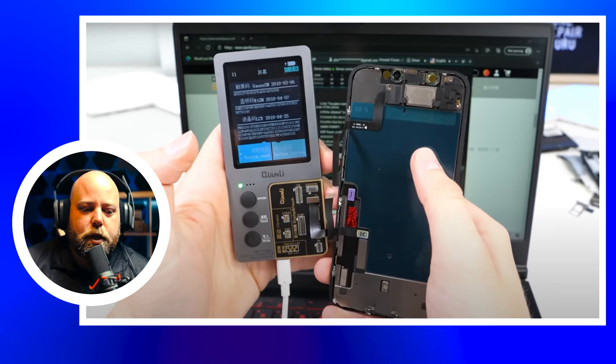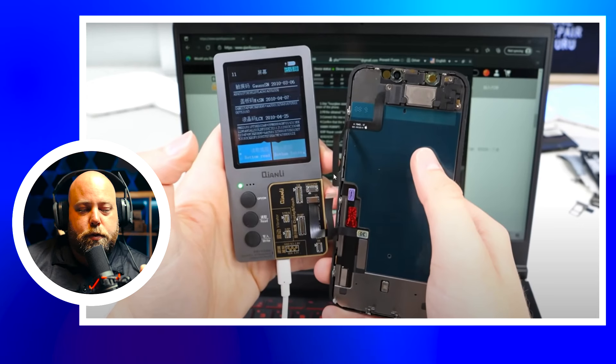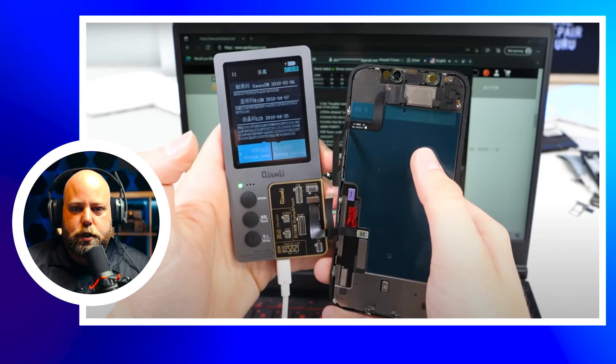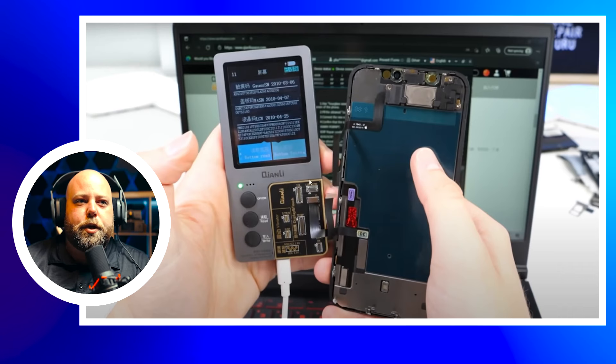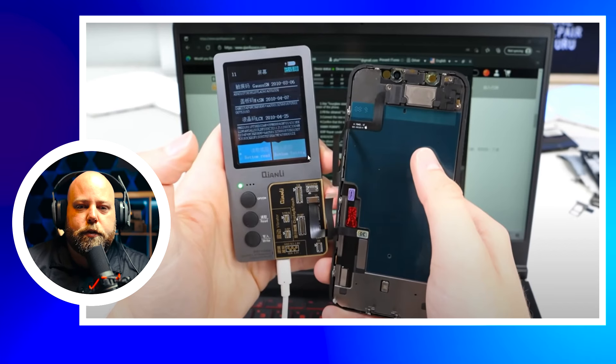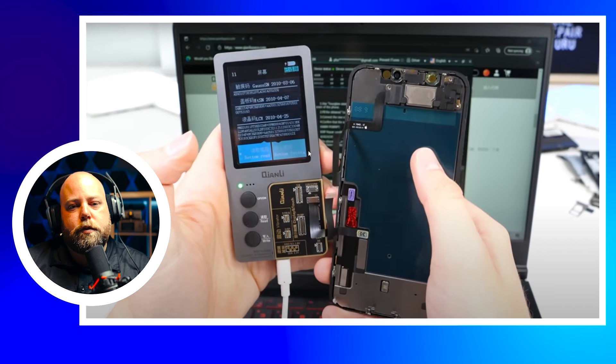We'll put the LCD back on the iPhone 11, boot it up, and this is the moment of truth. The replacement screen already on the phone is a Mobile Centric screen — you can see the red Mobile Centric sticker. The reason I point that out is because not every aftermarket screen is True Tone transferable. With Mobile Centric screens, you can transfer True Tone to them. You do have to know what programmer to use, because some work with originals and have a separate board for aftermarket screens if you want to transfer True Tone to them.